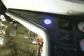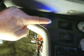Once the engine is started, the flashing stops. I'll purposely let it stall to show that it re-enables by flashing again. We'll start it again. As long as the engine is running, you can push the button as many times as you want — it does not crash the starter.